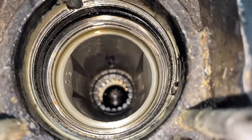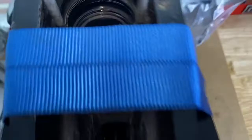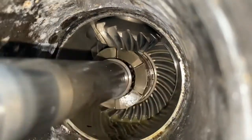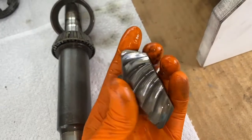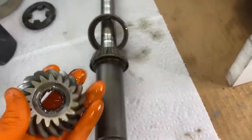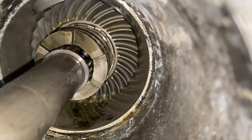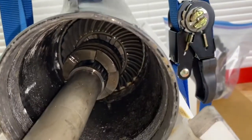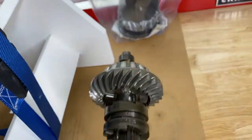A closer view of the lower unit portion that the driveshaft slides down into — you can see the pinion bearing that the driveshaft slides through as well as the pinion gear. We'll go down below and inside the lower unit, push that clutch dog back and rotate the pinion gear. Just by shifting the propeller shaft to the left and slightly up and down — there's the pinion gear right there. It's very lubricated, which is a good thing, and overall it's in good condition. Coming back to the propeller shaft, the manual states to shift the propeller shaft to the left portion of the case, which allows the rear side of that gear to disconnect and loop around the inner shift crank. Pull this out carefully — if it's not coming out, do not tug at it. There it is — the rear bearing and forward gear, and there is the clutch dog.